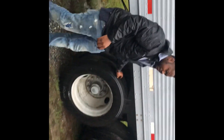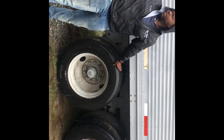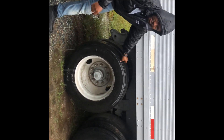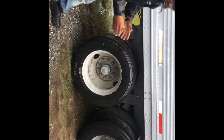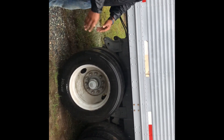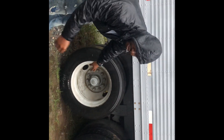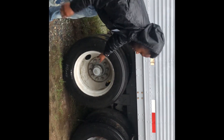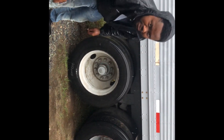These tires — got to have two-thirty-seconds inch tread depth, no less. Make sure you got two inches of space between the tires and the two rims on the inside, no space between those rims. Axle seal — the only way you can check that is if a mechanic checks it. It has grease. The ones in the front have a hole.